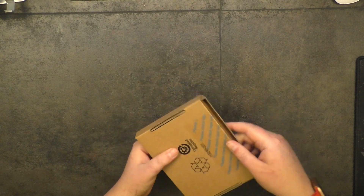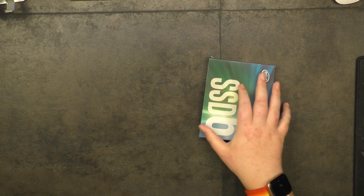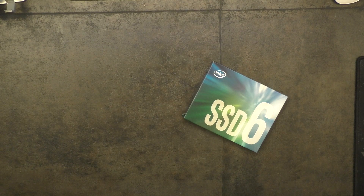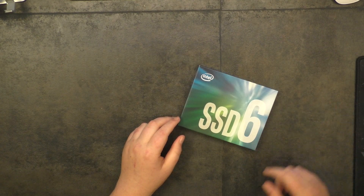I ended up picking up a thing on Amazon — it's one of these. You can grab one of these and an NVMe adapter for the later MacBook Pros. The SATA-based Retina MacBook Pros have them too. This is a nice alternative because Apple SSDs are absolutely pricey on eBay — the 1TB one goes for around $300. This option sent me back all of $99, and the adapter was $15.